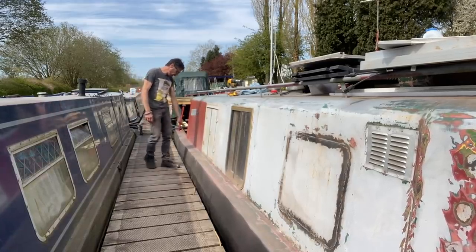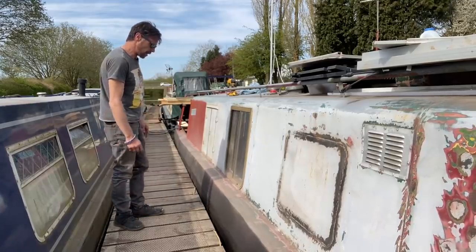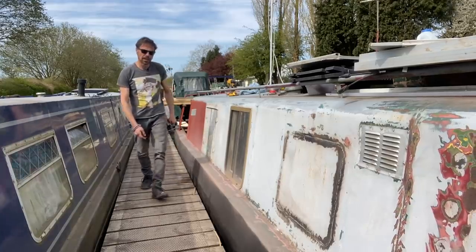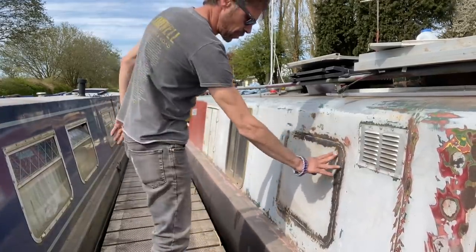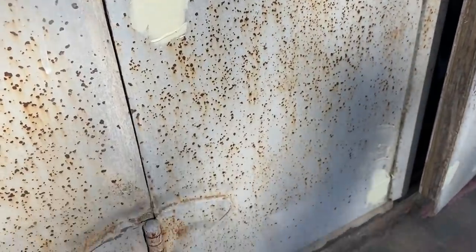The plan is now to tidy up this area all along here, and then I need to put some filler in on this hatch here, and just around there - those are the two bits I need to fix now. So I've filled in all the holes using the same two parts, and then over here I've done the same around there. I'm going to sand all this back now and hopefully see if it's good enough to put some red oxide down.